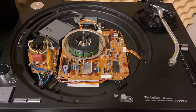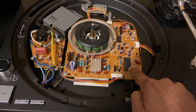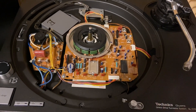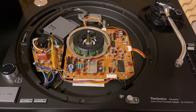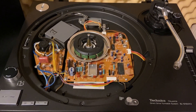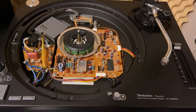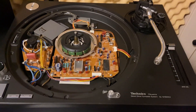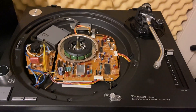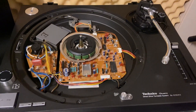There are other posts that will tell you that you can stick a heat sink on AN6680. I did test that theory — I cut up a heat sink and stuck it on there just to see if that was actually the problem as a way to troubleshoot, and it did work for about half an hour. Obviously that wasn't a permanent fix, but it did prove that the pitch fader wasn't actually the problem and didn't need to be replaced. I did take the turntable apart and gave the pitch fader a good clean on the inside just for the hell of it.